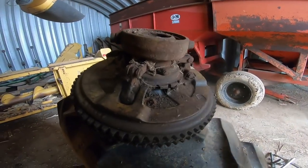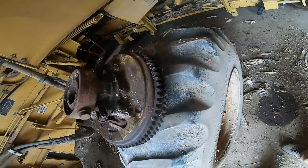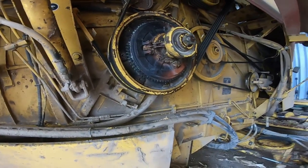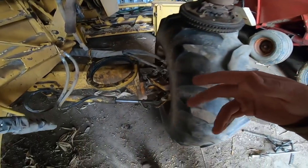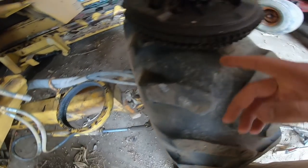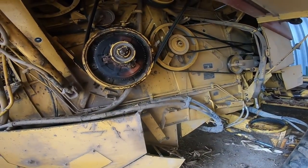That bearing's a little dry, but this is a clutch setup we have from the first TR70. That was a long time ago — it was a cat diesel. So we're gonna pull this stuff apart, try to get something on video, and hopefully New Holland was smart enough that this clutch and that clutch are interchangeable. We took the ring off, and the ring mounts to these holes around the big pulley here. It has the teeth in it that mesh with these teeth, and that ring fit around this clutch. As far as Dad knew, that one was still functional. So let's get to busting knuckles.